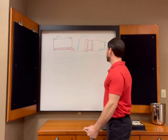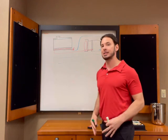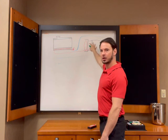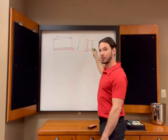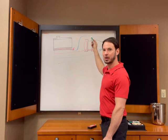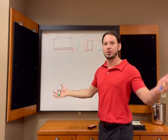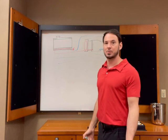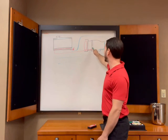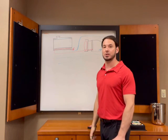So for that reason, we don't want to overcool the fluid. Best case scenario, everything's working completely correctly as it did on paper. All you're doing is using more energy in the pump because the fluid's thicker and creating more frictional losses. So you're basically losing horsepower and efficiency. Like I said, worst case scenario, your line pressure's already low. You're going to drop it even further and you're going to burn up your transmission.